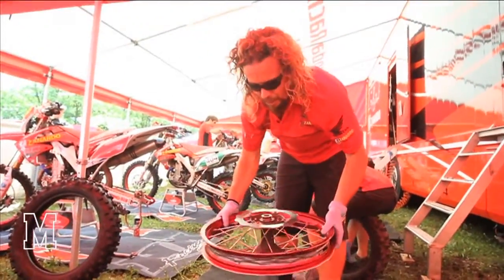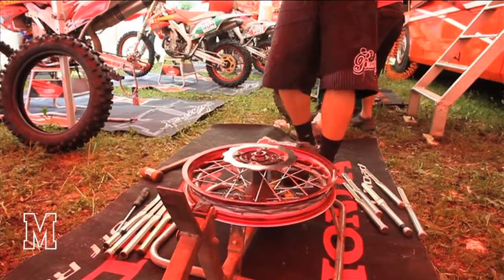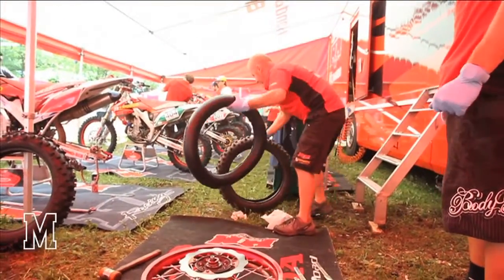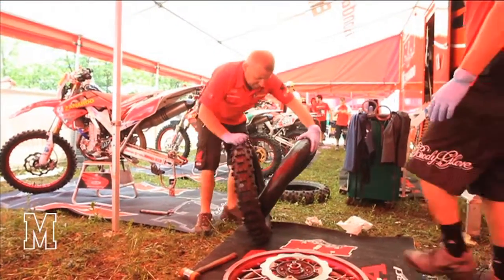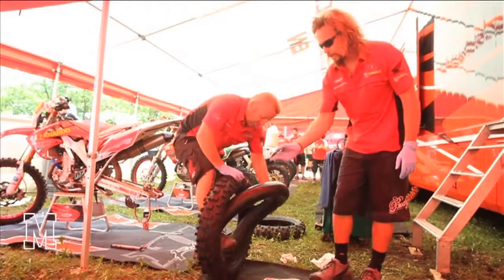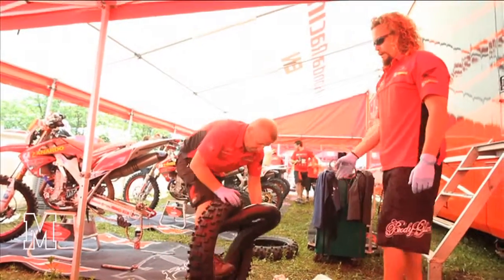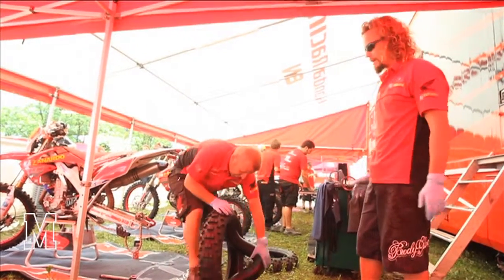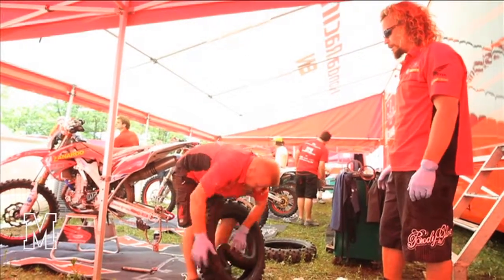Then, to mount the new tire, I'm using it here with the disc on the top. It's one day. And here, my mechanic Luca has greased the wheel inside the wheel with vaseline, so that the mousse does not dry and break during a day of 8 hours. It remains always in good condition.